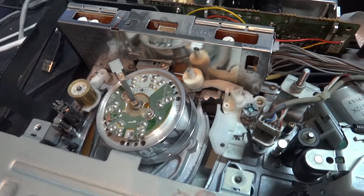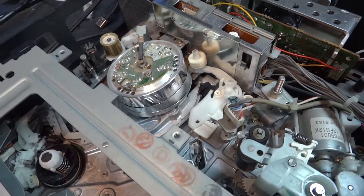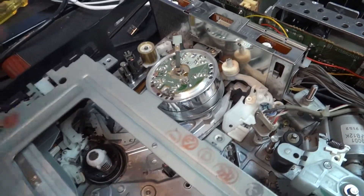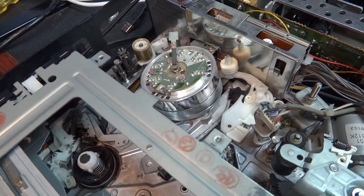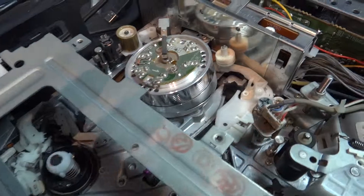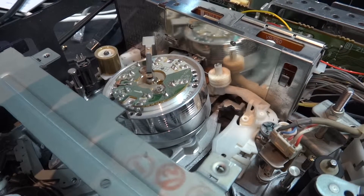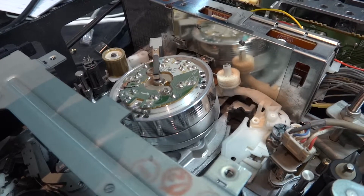In a future video I'm going to dig out my old Beta machine and put up a video showing how Beta machines thread the tape and how they differ. The Beta machines always kept the tape threaded, like this machine does. The early VHS machines used to thread and unthread the tape when you went into play or stop, which is why early VHS machines couldn't give you a picture in fast forward. Beta always kept the tape threaded, but the threading mechanism is different — it has a larger head drum and a totally different threading mechanism. We'll find a Beta machine and tear it down on a future video. See you next time.